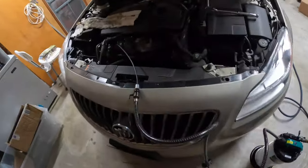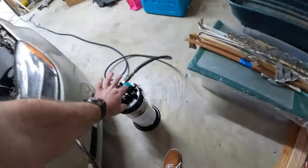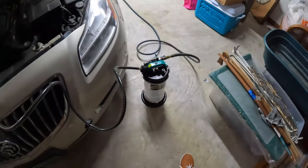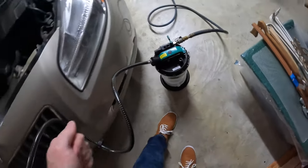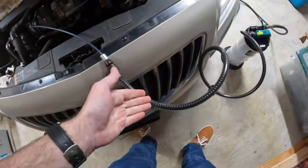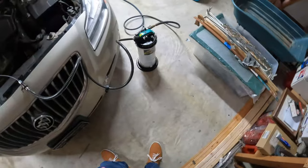Now this has got six quarts. You don't have to use this for oil — you can use it for coolant, brake fluid, everything. It tells you if you're going to use it for coolant, there's a different hose you use for coolant. But you just let this run. And as you can see, there's oil in here. Make sure you don't have any leaks and then you just watch it. Once you start seeing bubbles, do not let it run dry for a while because it can damage it internally.